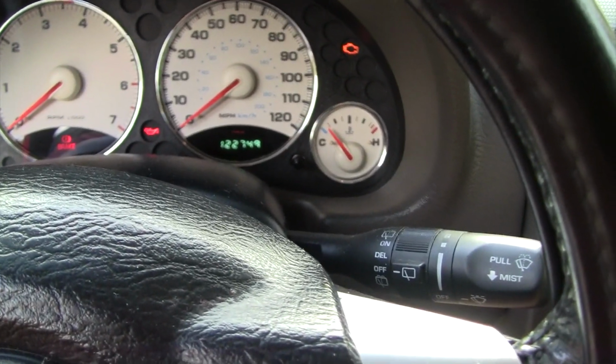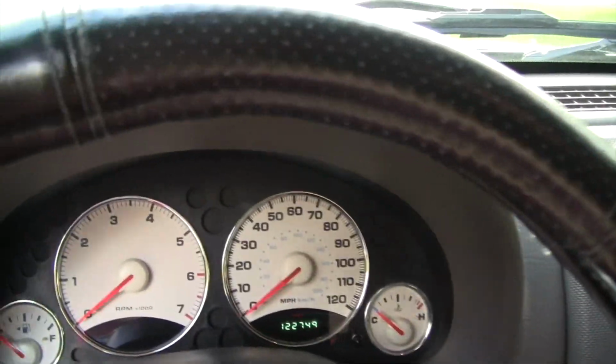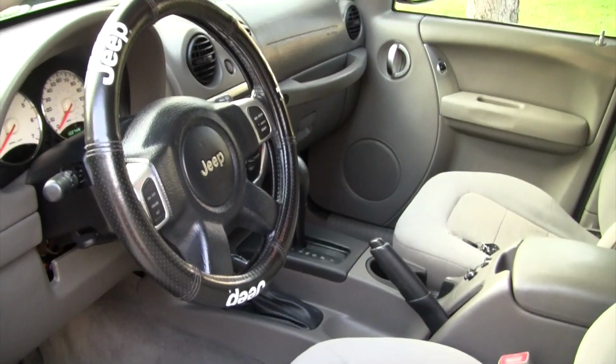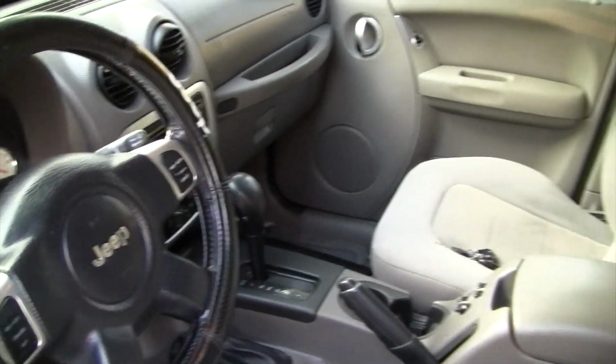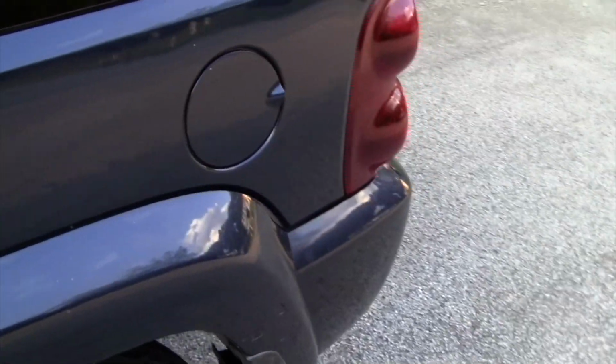That's the current mileage. This vehicle, as I mentioned in the previous video when I first bought it 2 years ago, they did put a transmission in it, a used transmission. It still seems to be holding up, which is nice. I was concerned because the clutch volume index was a little bit out of range, which means the clutches are kind of worn.